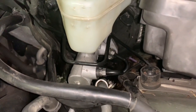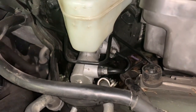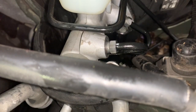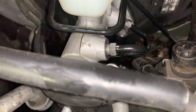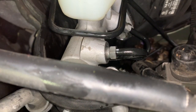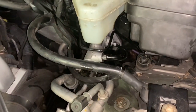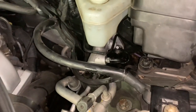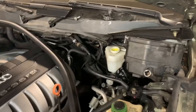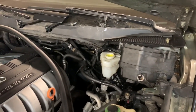Now with the line dripping well, we can go ahead and close off the one and wait for the other one to start dripping as well. Now we've got our rear line leaking really well, and it's time to get our assistant in the vehicle. I'm going to go ahead and close off my line so it doesn't constantly drip all my brake fluid out. Now because we're going to be loosening these lines a couple of times, we're only going to tighten them up basically finger tight.